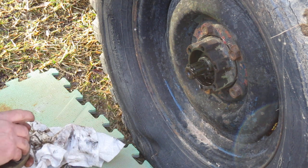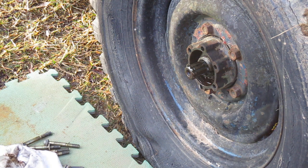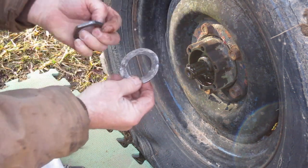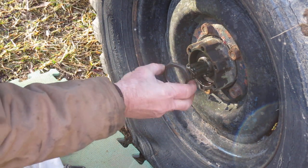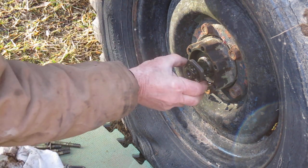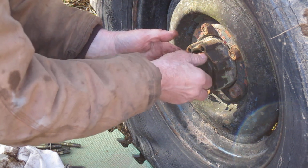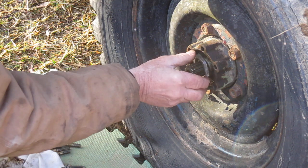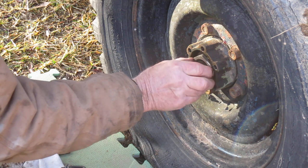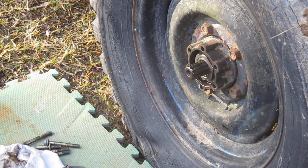To put this back so it's safe, I have to put a spindle washer on there, which I've got up here. Here on this you have this part that goes in there and locks that in. Then you take the spindle nut — there's usually a cut side and a smooth side. I like the smooth side out. This is not a perfect how-to; it might be a more detailed how-to later. This Jeep is going out to somebody that's going to restore it. There it goes.